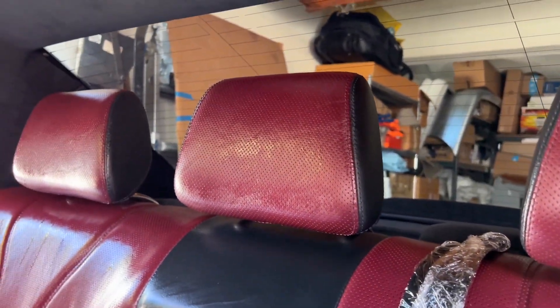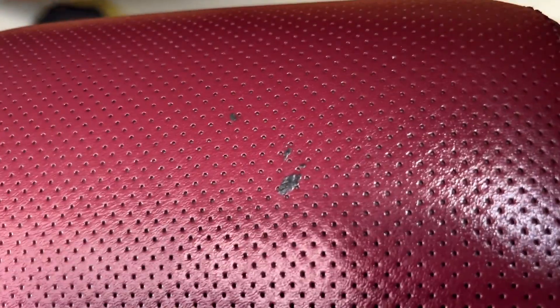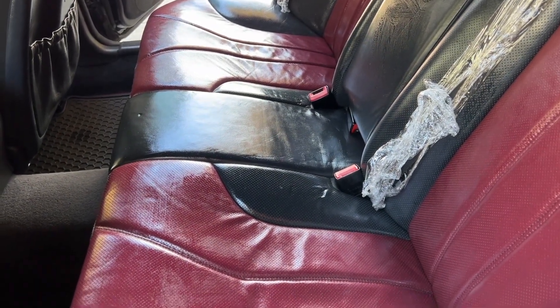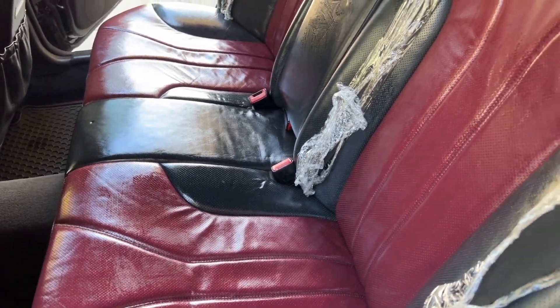The rear headrests in particular were really dry, so I'd like to see how much this softens them up. There are also some stains on here that a normal cleaner wasn't able to remove — I'm curious to see if the Leatherique can get them off. We're going to let it absorb, and as it becomes less shiny in some areas, I'll reapply. The leather is already warm and it's a warm day. Ideally you'd have the car in the sun all day, but my garage will be about 85 degrees since the car has been running and the engine is hot.